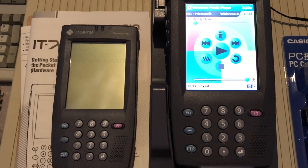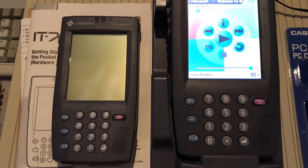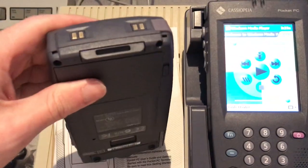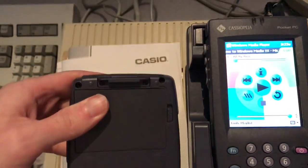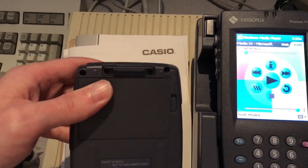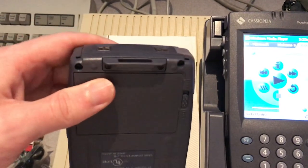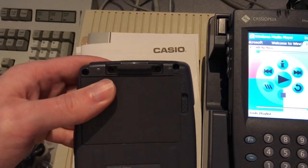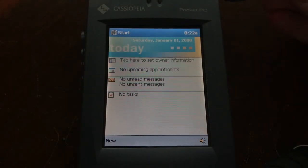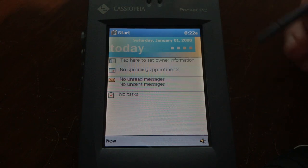So what do you have to do to get one of these going? Well, you have to install the clock battery. To do that, you actually have to unscrew a panel on the bottom — you see those two screws? You undo those, that little door comes out, and the CR2032 clock battery should be accessible. The color one is fully charged with the clock battery replaced and ready to go. Got it to start after some time charging in the cradle.